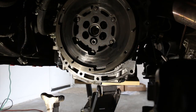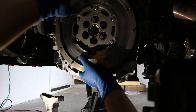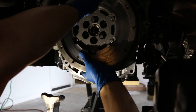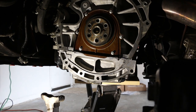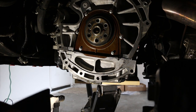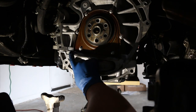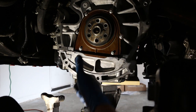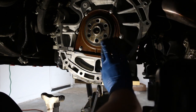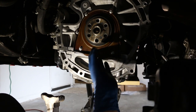That is hot — a lot of friction from taking those off. That is heavy, and that is your rear main seal. Good to check: this engine that was swapped in only has 16,000 miles, and you can even see the RTV is pretty fresh, so this shouldn't be leaking — and it's not. I'm going to clean this surface off so we have a good fresh surface, clean up the flywheel surface so that when we put the clutch on there won't be any debris.